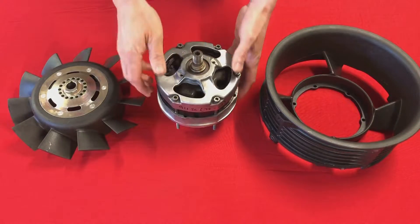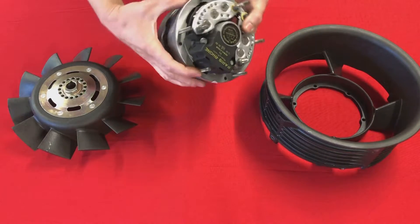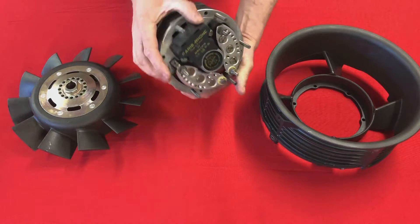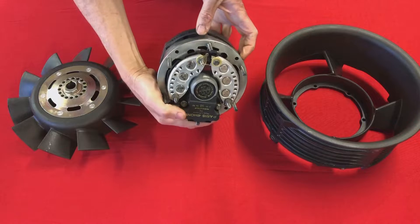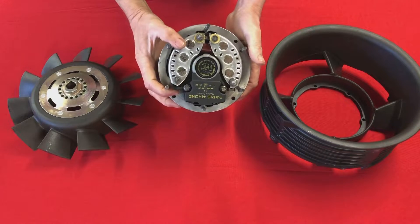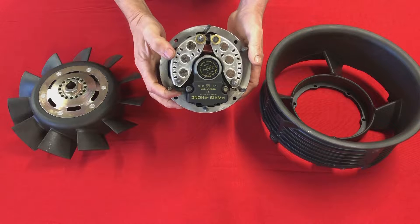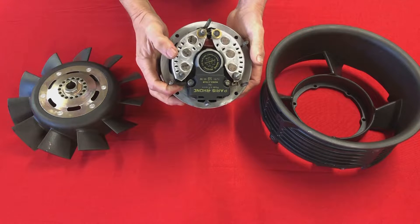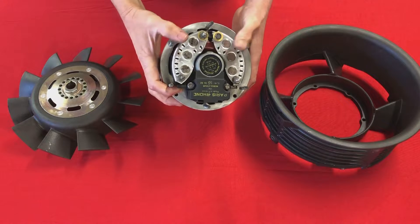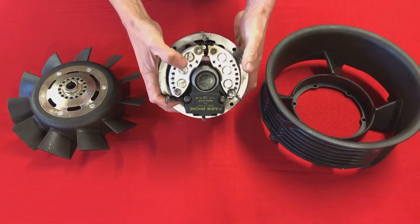This particular unit has an internal regulator. The early units had an external regulator and those are prone to failure. The typical symptoms are the battery voltage rises up, which can cause all sorts of problems with other parts of the electrical system, particularly the CDI unit fitted to the early cars.